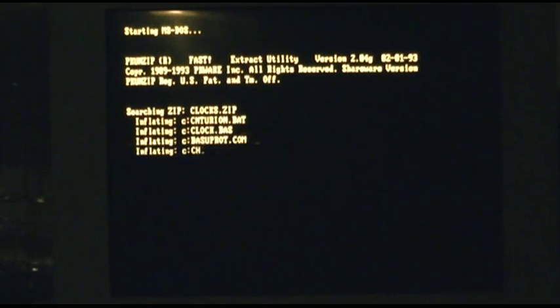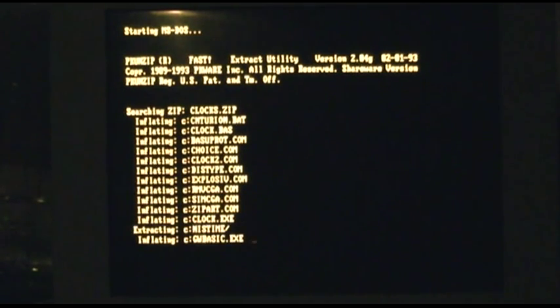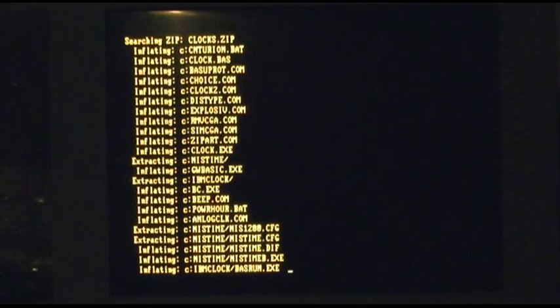The second thing is the RAM drive, why that's necessary and why it unzips this file, is because a 360K floppy disk simply does not have enough room between the system files and all these utilities and whatnot that I keep on it. But to run some very basic utilities here, including GW Basic, and stuff that probably wouldn't need any more than maybe 100 or so kilobytes of RAM, I can allocate a lot of that, about 320 kilobytes if I'm not mistaken, to be a RAM drive for it to have all of those files stored.